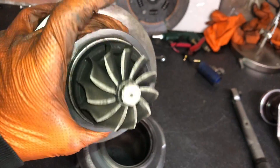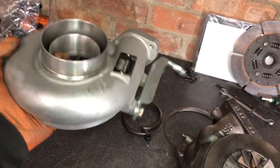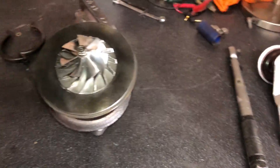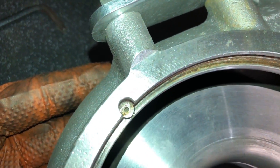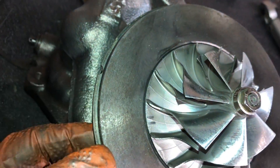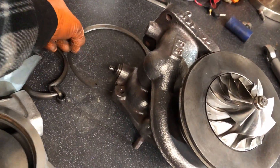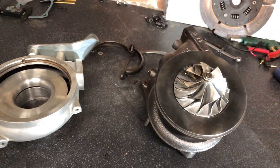You don't have to put it on the car, mess around with it, take it back off - you can just lock it in place and it's done. The compressor housing is looking fresh, that's going to look nice going back on the core. It's also got a notch inside here where it lines up with the compressor - there's a rivet that locks into the compressor housing. So now this is all cleaned up we can start bolting this back together. Cleaned up all the brackets, all the bolts, got some new fresh bolts, and obviously all the gaskets are going to be replaced.